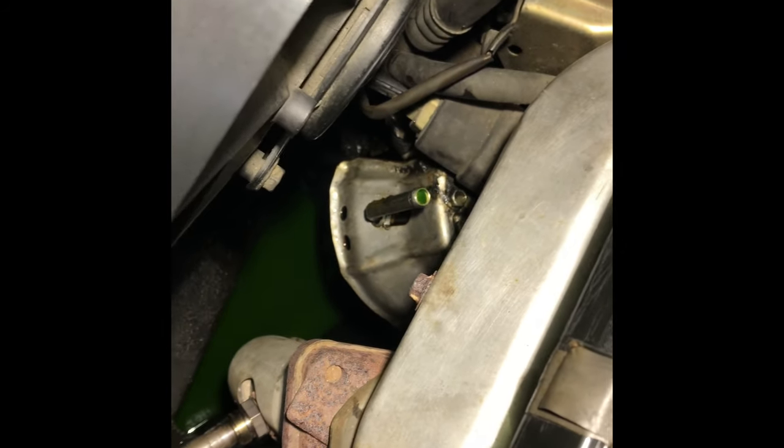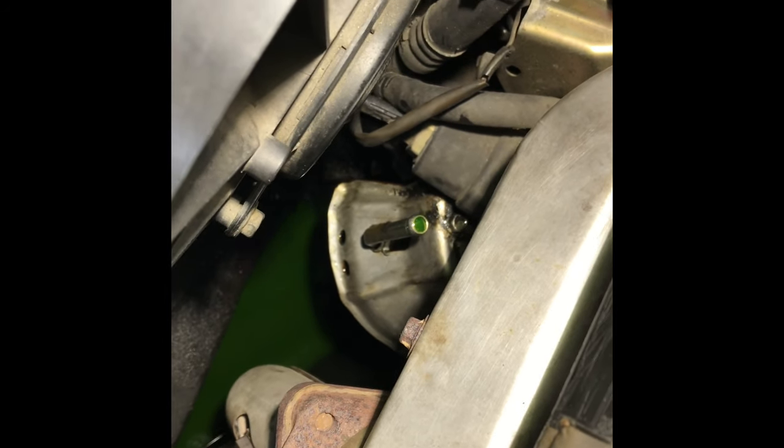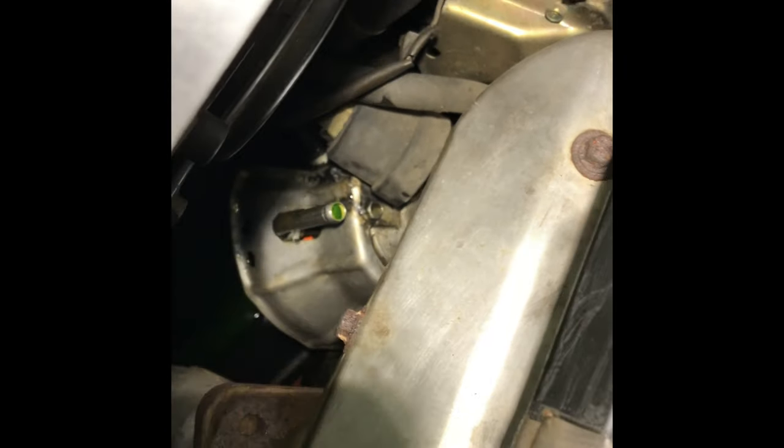If you can see in there in the engine bay, I disconnected the oil cooler fluid line, or coolant line — so that was okay. I'm capturing it in a bucket down below, and then there's two 10 millimeter bolts that I have to get off to get this cover off, this heat shield off, and then I should be able to get the oil filter off and then get to the gasket that's leaking, or that's failed.